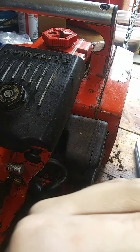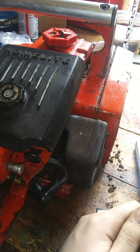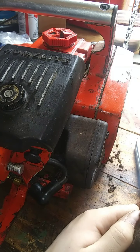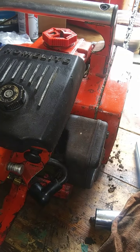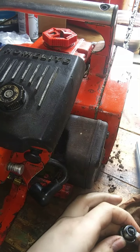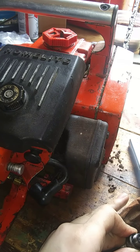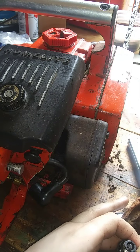Okay, so the plug is wet, very wet. Whew. Yeah, gassy, oily. Almost makes me feel like we weren't getting fire, maybe. We were spraying the gas, and we weren't getting any fire. So maybe what we did is actually going to help. But I don't know. I'm going to go ahead and try to clean this thing up a little bit, though. Get a screwdriver here. I'm just trying to scratch up some of that oil off it and get it kind of cleaned up a little bit.